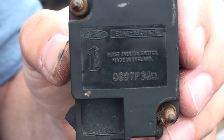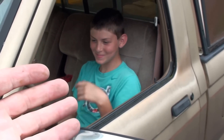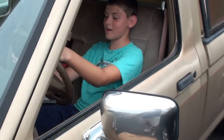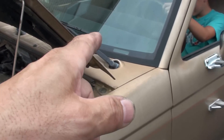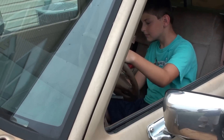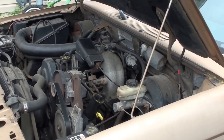There's a part number if anybody's looking for one. We got everything back together now - we've got the jumper in there. The pump's hooked back up. It may take a second to prime. Go ahead, push the clutch in, put it in neutral, crank until it starts - and it should start here. There we go! Awesome. All right guys - it's making a little weird noise there. Oh, you were turning the steering wheel - it was the power steering pump. He's messing with me. Well, that's good. I appreciate you guys watching. Hope that helped you out. Hope you enjoyed the video. Don't forget to follow and like - I'll see you on the next one. Take it easy.